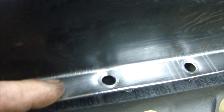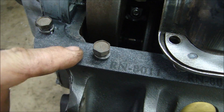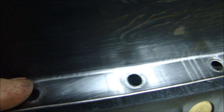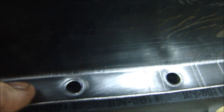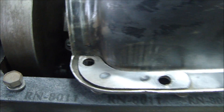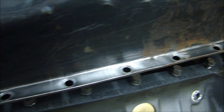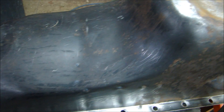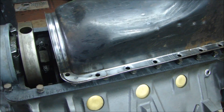This is very typical of when you use a cork gasket - I'm using a paper gasket on these. When you use a cork gasket and you get a leak, the idea is you go in there and tighten it down. Well, you're tightening it down but you're also bending the oil pan. If you look on the side here, you can see that this part of the oil pan is all bent all the way down - this is all crooked from someone cranking these bolts real hard and denting all of them. They're all dimpled in. So the entire oil pan surface is not flat. I'm going to have to hand hammer this whole thing, get it nice and straight before I can put the oil pan on. And also scrub it to get all the rust off, because there are layers upon layers of undercoating and other stuff on there. So I've got to clean up the oil pan and fix that before I put that on, so I can start the next video with putting the oil pan on.